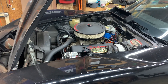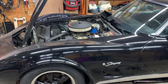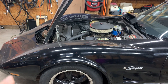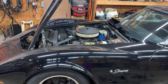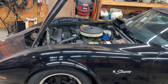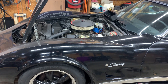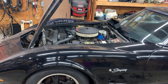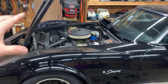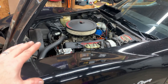So I quickly adjusted the timing and knew at that point that's what the issue was. Going back about two and a half years when I initially bought this thing, the car ran like crap. I did a normal tune-up — plugs, rebuilt the carb — then verified timing. A small block 350 Chevy should be anywhere between 12 and 16 degrees initial timing, but this thing was at zero, which explained why it was running so badly. I adjusted it and immediately fixed all the issues. Then two years later, driving again, the timing was off again — off by about another 12 degrees.